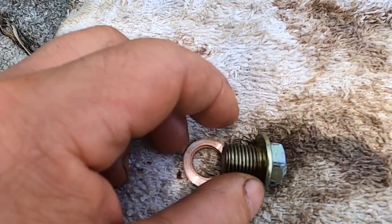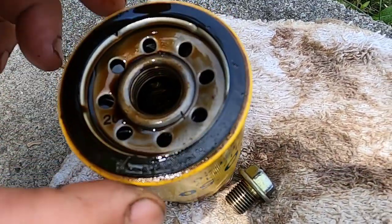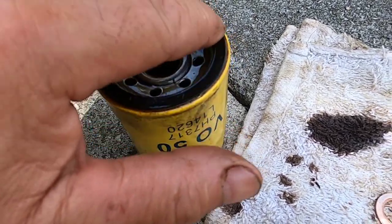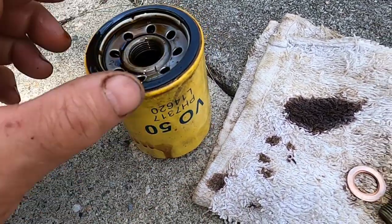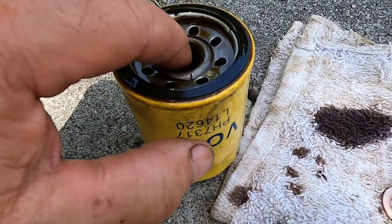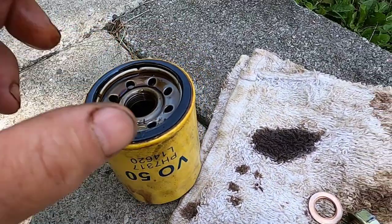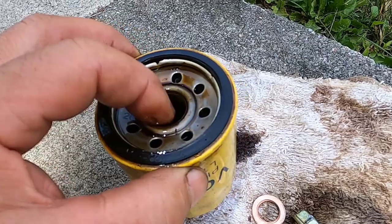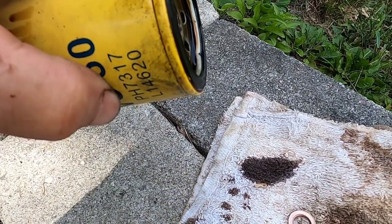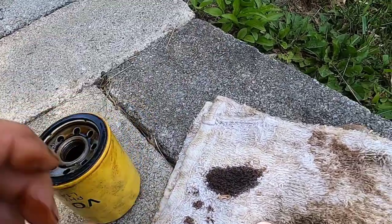So I'm letting that oil drip out of there and I'm going to put the new filter on. One thing when installing the new filter is you want to get some fresh oil and rub it along this rubber gasket — it helps seal it. Now because this filter gets installed straight up and down, I'm going to put some oil in the new filter. Because when your engine first starts, there's oil in there that's going to be pumped out, and it can't hurt to have the oil already in the filter. On my blazer the filter goes sideways, so there's no way to get oil in it that way.